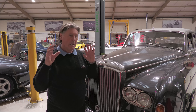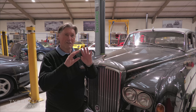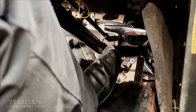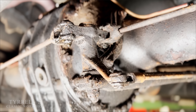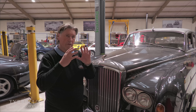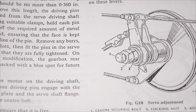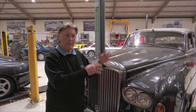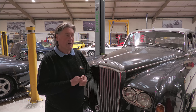Not only can the brakes fail to operate at full efficiency — and you sail majestically on no matter how much you press the pedal — but there can be all sorts of other problems. Once somebody's been at this very delicate balanced trapeze mechanism with spanners, it's very difficult to reset, because it's almost like a Stradivarius violin: everything is very carefully balanced and interplayed. Pressing the brake pedal operates a linkage underneath which goes directly to the back brakes — that's where your 30 percent comes from. Then at a certain point a mechanical friction servo cuts in and works the rest of the braking system, but the car needs to be moving for that to work.